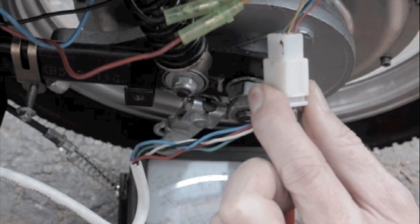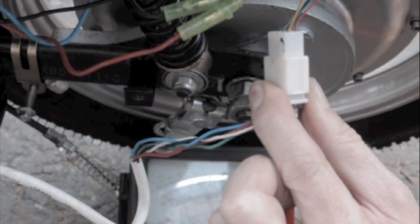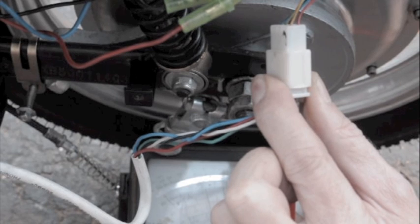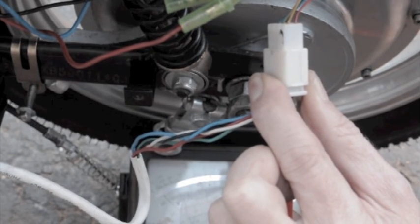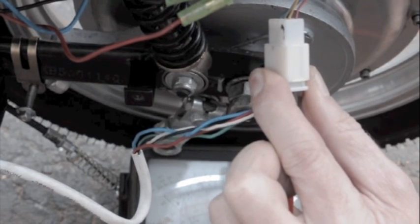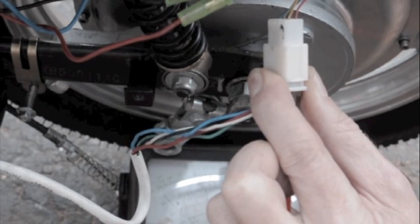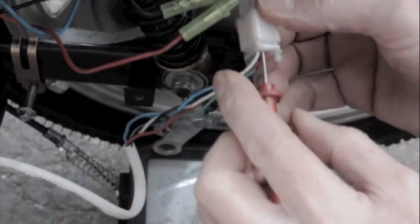But two out of the three aren't going to complete. Oh, that's interesting — there's one spot where it's dropping to about half voltage but not turning off entirely. There's about a few degrees where it's just not turning off entirely. I don't know what that means, but I would say that that sensor is probably suspect.